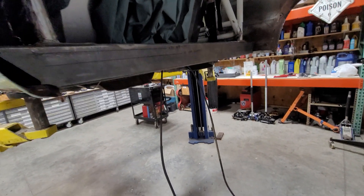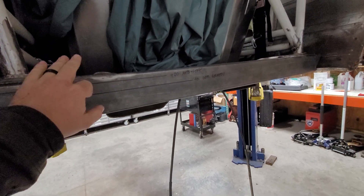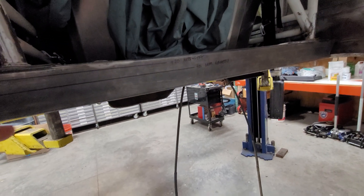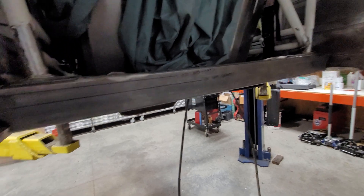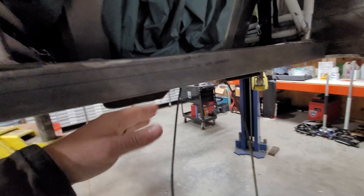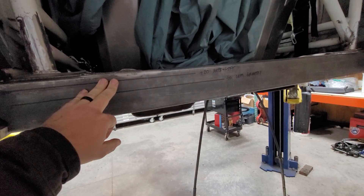I've described out where the OEM geometry is for a MK7 GTI as well as some additional geometry points that I think can help with anti-lift in the rear under the brakes. The OEM position I think will be really good and should give me more rear lift — great for the autocross spectrum. My wife and I still do a bit of autocross, and this would be an easy way to adjust to something more loose, especially where aero or a flat floor and diffuser doesn't really help. But on bigger tracks I want more stability and believe I can achieve that with anti-lift geometry in the rear trailing arms.